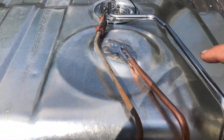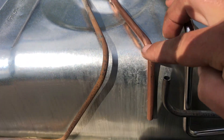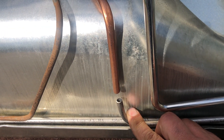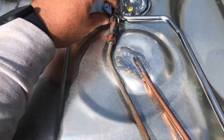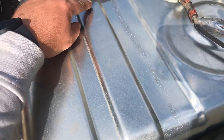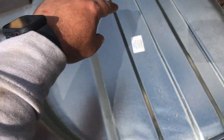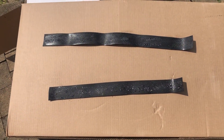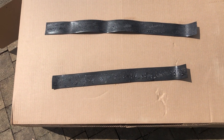So I got a new tank and new lines except for one line. This vent line comes off at an angle, so I had to cut the new vent — I'm just going to put a rubber hose between the two. It has rubber hoses in line with it in other spots. Got the new sending unit in. It's not exactly the same but it's close enough. You can see I got some Super 77 glue here along the straps — these are anti-squeak pads I want to glue in place. Letting them tack up and then I'll put them on.